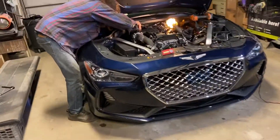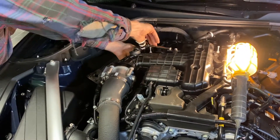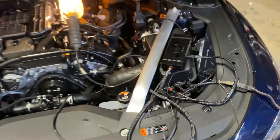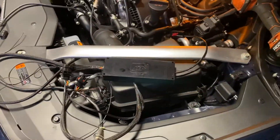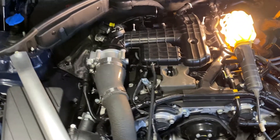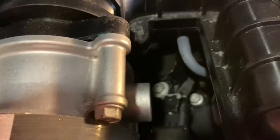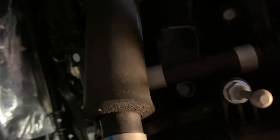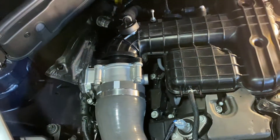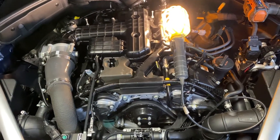Back to the G70 and Justin over there tightening up that back one, then the front one, and that's it. This coil pack — back coil pack gets popped off, then the center one gets popped off, pull through the back over here. Stick your extension, swivel, and spark plug wrench right in there and pop that one right out. Good to go.